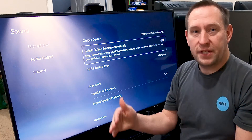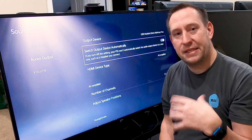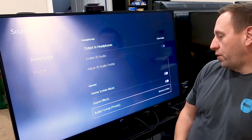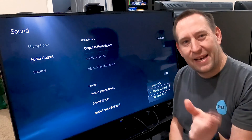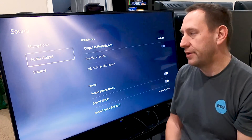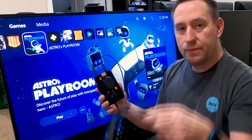Once I've got it into this setup with all the settings from my previously posted videos for the full sound, but I don't feel like I'm getting full sound, there are a couple things I can do. One setting you really want to pay attention to is Audio Format Priority. In one of my videos I did say Linear PCM — Linear PCM does have sound, but certain sounds seem to be missing. So you want to actually put it on Dolby Bitstream. Make sure it's on Dolby Bitstream and then all the sounds should be good. Now I can go to the game and you can hear the game music with all my cords connected and the white connection light showing.